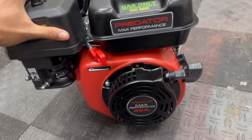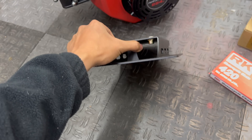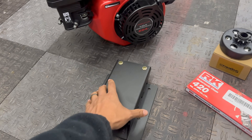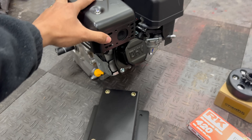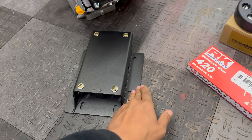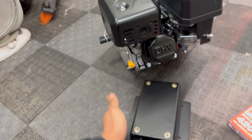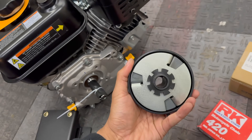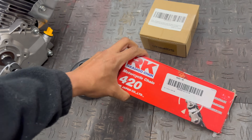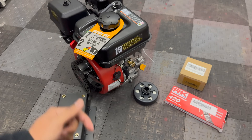You're probably wondering how we're going to be mounting the engine onto the back of the cart. I'm going to use a riser plate designed specifically for Predator engines that raises the motor about an inch and a quarter to make more clearance for the cover — it comes pretty close to the right side track. I like the fact that it has a wide mounting plate surface area at the bottom, giving me a lot of options to reposition it so the sprockets align correctly. I also have the option to remove it later and go with a different engine. For power, I'm using a centrifugal clutch with a 10-tooth front sprocket and 420 chain by RK. Everything used today will be linked in the description.